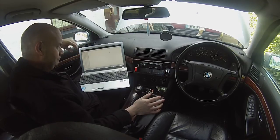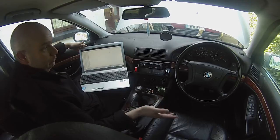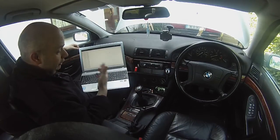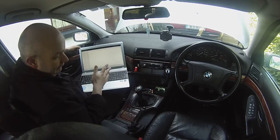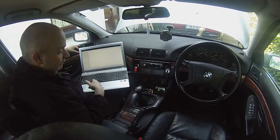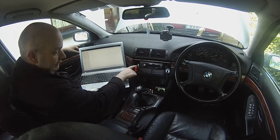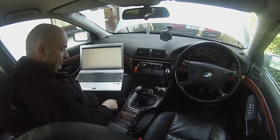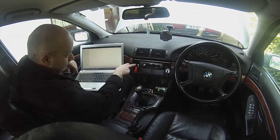So what we needed was a way to override that shut off, so that when we pull the car into a CHAdeMO fast charging station, we can turn on those rear contactors so that we have pack power available to connect to the charger. There were a couple of ways I could have done that with the JLD 505, but what I elected to do was put a simple dash switch here to override that contactor. I happen to have one of these aircraft missile switch type things that you see synonymous with nitrous and all kinds of modified car stuff, so I decided to fit it here on the dash with a little bit of polycarbonate.